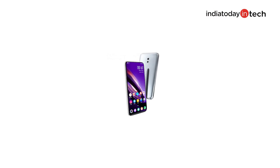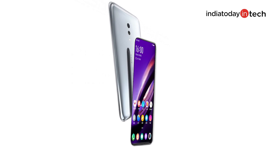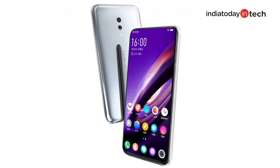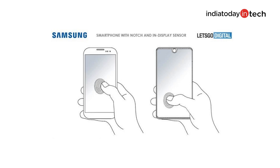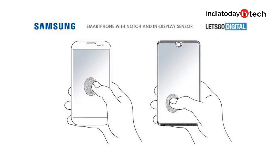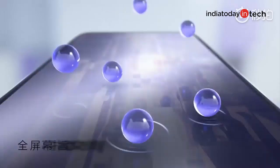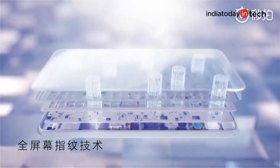You'll also not see a fingerprint scanner on the device, but it is obviously placed under the display. In fact, Vivo was the first smartphone maker to bring an in-display fingerprint scanner, and on the Vivo Apex 2019, it has made the entire screen area available for fingerprint scanning. There was a leak suggesting Samsung is planning similar technology, with a patent showing all of the screen area acting as a fingerprint sensor — when a finger is brought near the display, the display pixels light up to capture more accurate information from the finger and deliver it to the sensor beneath. Vivo is not using a single continuous sensor; instead, many small sensors are used to make the whole screen area available for fingerprint scanning.